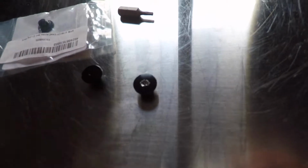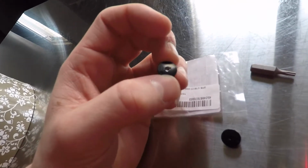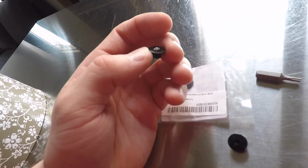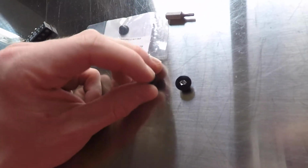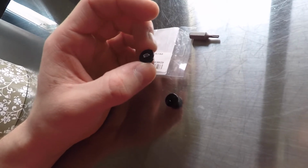And of course, as I was trying to undo this, the metal, this is most likely aluminum, a blend of aluminum, but this is alloy. The quality of the alloy is very poor and it's very soft. So I guess Shimano could have saved quite a lot of trouble by using, well, not just steel bolts, but something a lot more resistant, and it would not have been that much heavier. I know this is the Dura-Ace model, the flagship grade component for Shimano, but still this is not a place where you want to save weight, because the resistance and the quality of the build has to live with a couple of times that it will be undone, because this is a bleed port.